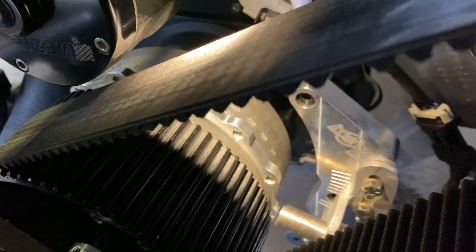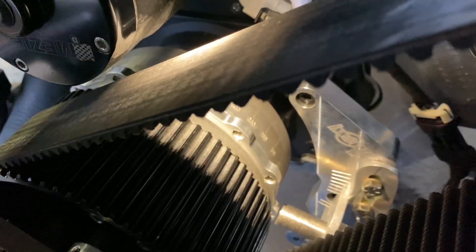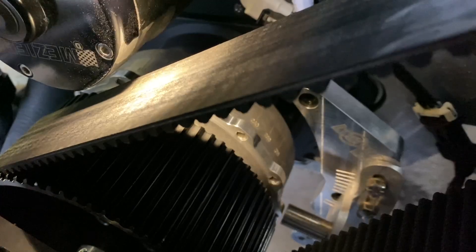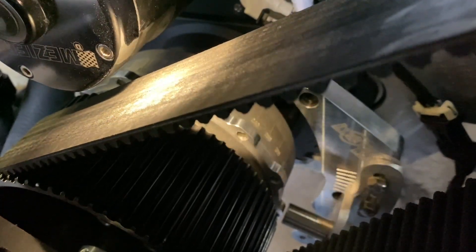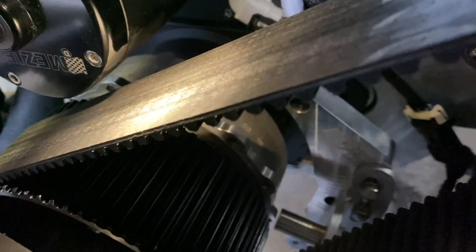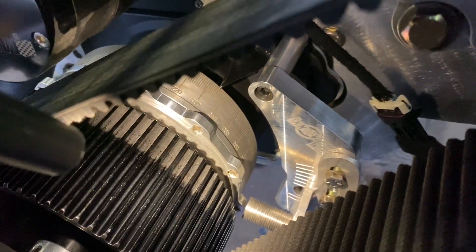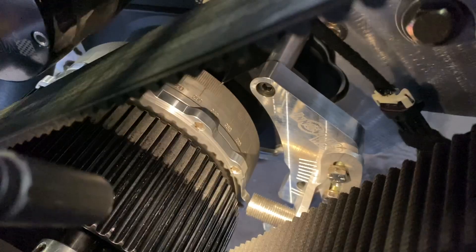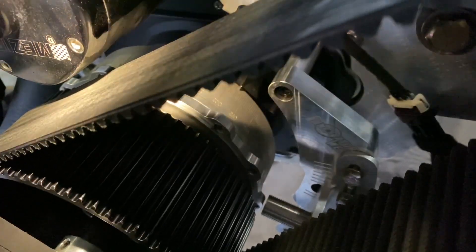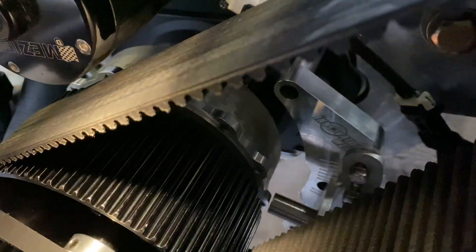That's why on this one, since it had 12 magnets, he had to knock one out. So now it's 11 magnets. You roll that missing magnet past the pickup, and when the motor is running, ideally you want it somewhere between 40 and 60 degrees before TDC. 60 degrees is what most people do — that's called the 60-degree reference angle. When that missing magnet goes by, it senses that and knows top dead center is a certain number of teeth away.